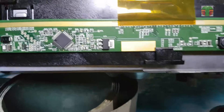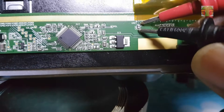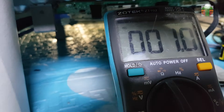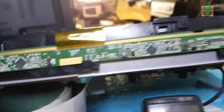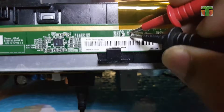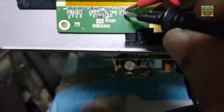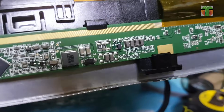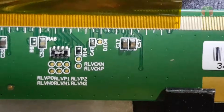The 4th COF is 1.3 ohms. The 3rd COF is 1.0 ohms. The 2nd COF is 0.8 ohms. And the 1st COF is 0.5 ohms. The 1st VAA COF capacitor is the lowest ohm reading — this capacitor is possibly the shorted one.